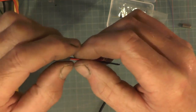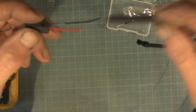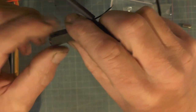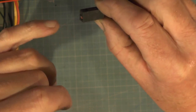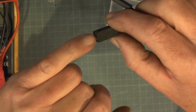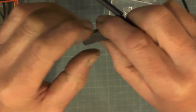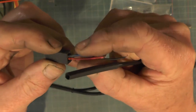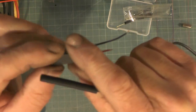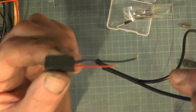And I'm going to now solder my two wires on on both sides, then I'll just mix a bit of two-part adhesive and just put a little blob at each end just to seal the reed switch into that, and then that'll fit underneath my brake casting.